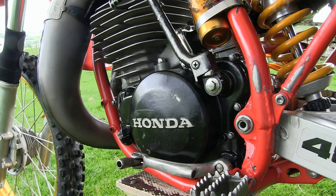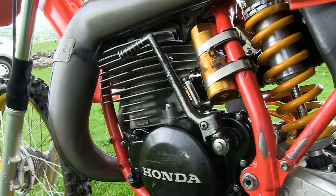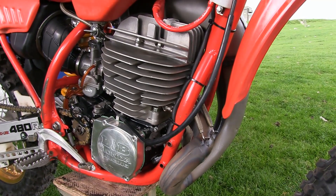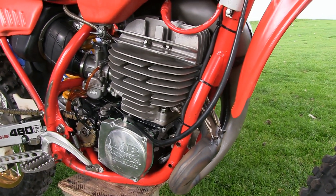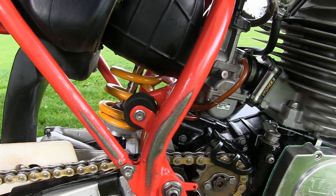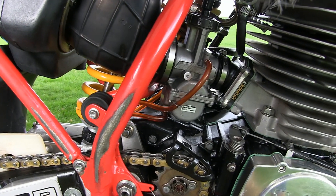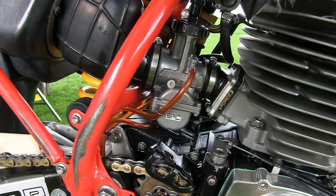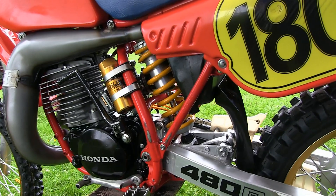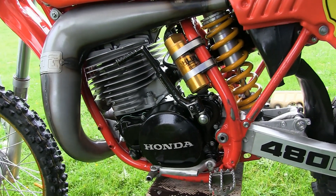The star of the show was this awesome two-stroke 480 Honda air-cooled engine. These big bore motors had a power band that was ultra-wide — from way down they would pull like the proverbial train and wouldn't stop as long as you held the throttle open. They had a 5-speed gearbox, wet multi-plate clutch, and fuel was fed through a flat-slide Keihin carburettor and a V-Force 3 reed valve block. These big Honda two-strokers liked a drink on the racetrack, but the power received in return was more than enough payback, propelling you to the head of the pack.